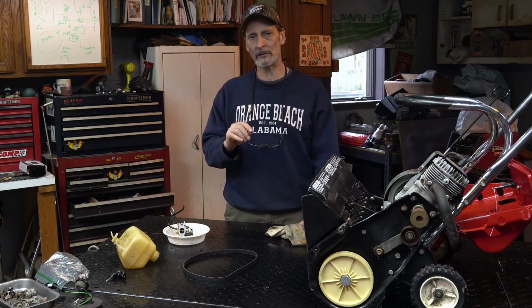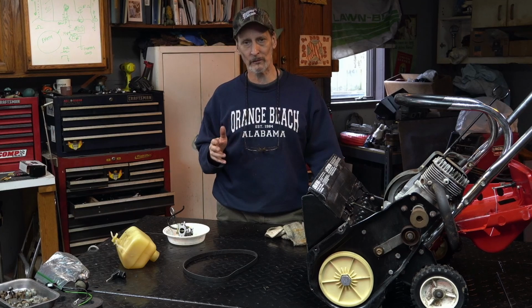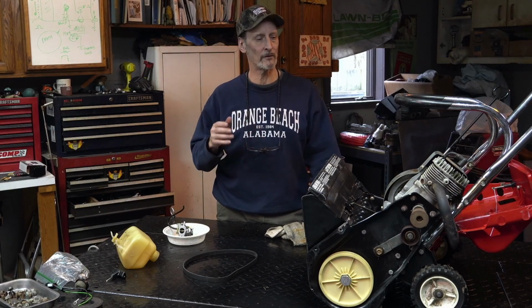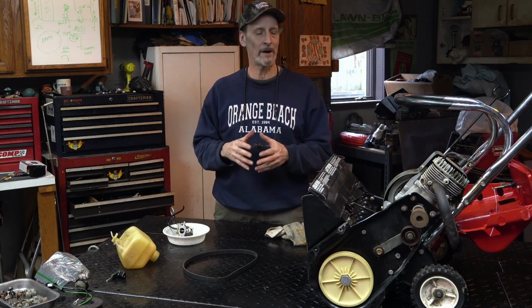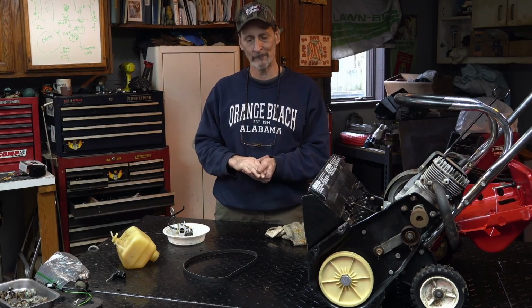And also, lastly, fellas, is the fuel. I think many of us know the issues with the fuel in general, with the alcohol in it, and then you have two-stroke additive. And if somebody didn't use a good additive, fuel, oil combination, they didn't get it right. And there was definitely evidence of oil in the motor. So it wasn't seized, because you wouldn't see probably any oil in the motor.